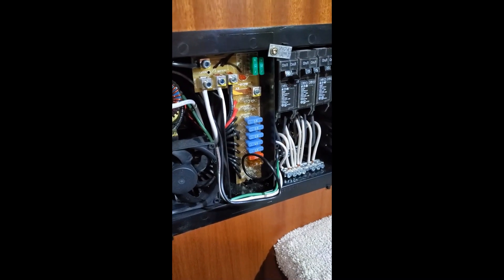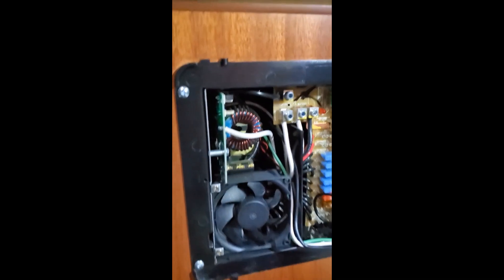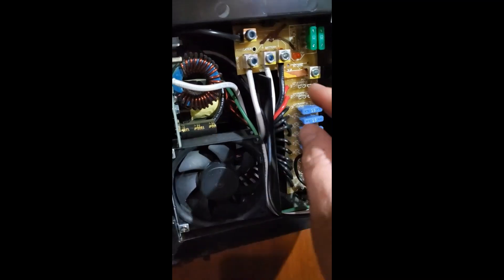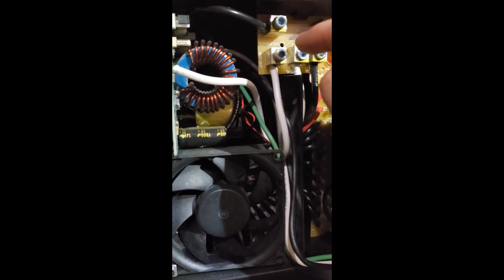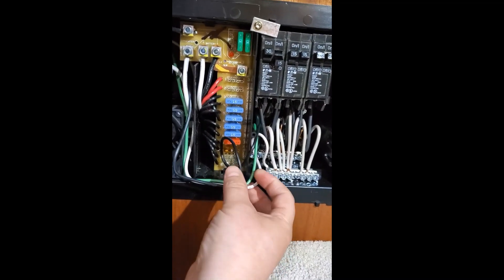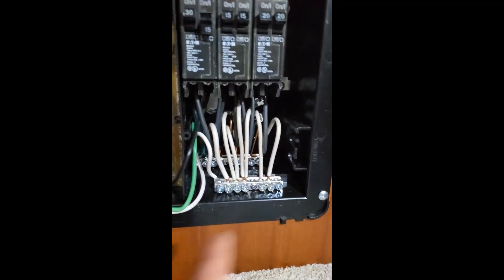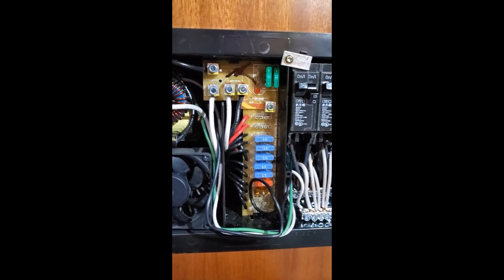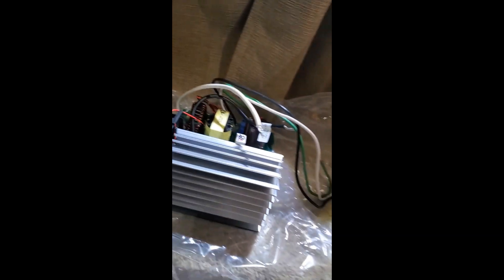These don't take too much effort to come apart. This is your converter. There are two connections here for the battery — they're labeled converter positive and black ground, which is white. On the other side you have your hot, your neutral, and your ground that go into the connector, your ground bus, and then your neutral bus. I'm going to be replacing that with the new lithium one. It's literally two battery connections and three for the 110 connection.